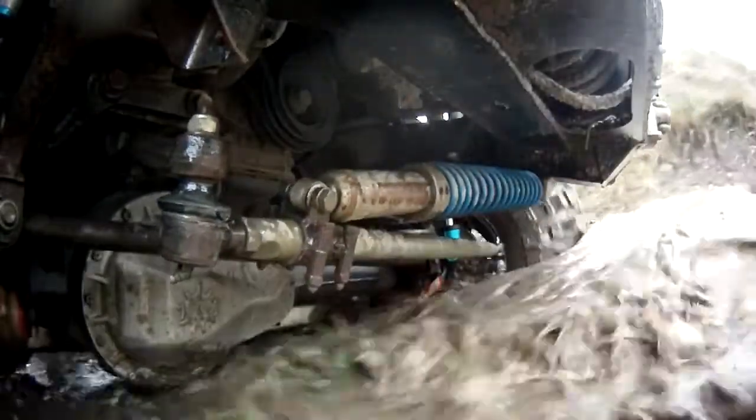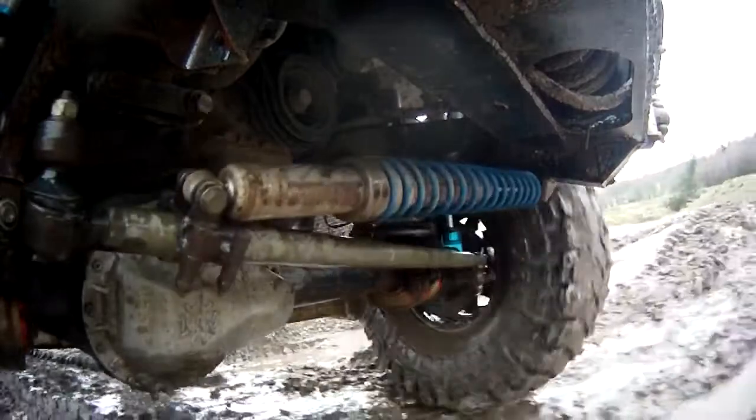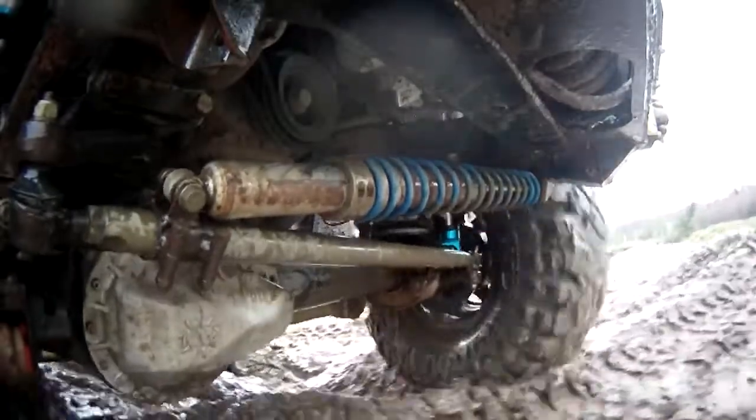Personally, I'm not sure on calling it a return to centre damper, as it will not magically return the steering to the centre on its own. You will still need to make sure you have the correct steering geometry and caster angle, but the damper does definitely help keeping the steering centred. Where the RTC damper really becomes an advantage is over rough, uneven ground with large tyres. Here it will aid control and straight line stability.